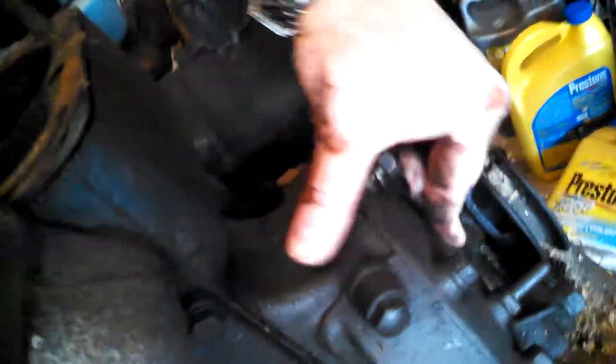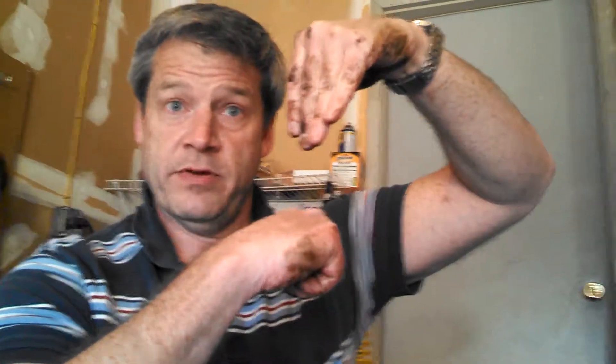So in here, as this turns, there's a gear right here, and that gear connects to another gear right here. So they mesh like a gear, and it turns what's called a camshaft down in here. That camshaft has something called lobes on it. So instead of being particularly round, it's got a thing like this that comes around, and that hits the bottom of this valve and pushes it up. Then springs will pull it back down when that lobe goes away.